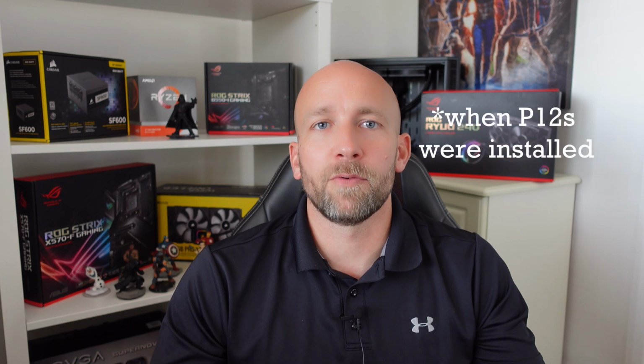Also, from the results, you saw that I ran everything at 100%, and it was well under the turbo level of the ROG fans. But it all depends on your use case, really. Are you going to use this cooler in an ATX, a mini ITX, a micro ATX? You know, what case fans are you going to have? So it all depends on what your tolerance levels are for heat and for noise. Obviously, ultimately, it's how you're going to run them and what fans you're going to use. But if you're going to use the stock fans, you're not going to have too many problems, to be honest.